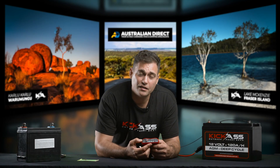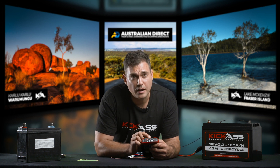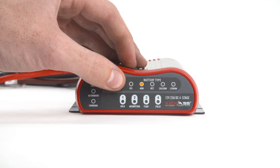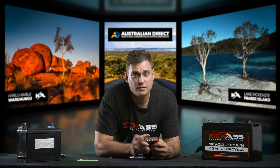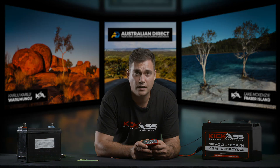Just a quick note — we haven't connected the start battery to the DC charger at this stage. After you've set the battery type, the light will go off and it will only flash from time to time. If you want to check, just touch it one time and that will confirm the battery type setting. But don't be alarmed if the lights all turn off. The next thing we're going to do is connect the start battery charging cable to the DC-DC charger input cable.